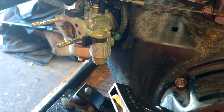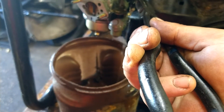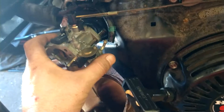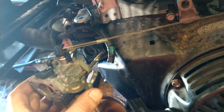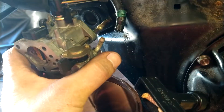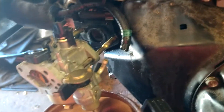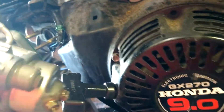Go ahead and pull the fuel line and drain all the gas out — you're going to want to clean the gas tank. Once you've drained the gas, pull the carburetor out to where the studs are, then turn the throttle all the way up and push it straight up so it comes out. Now we can rebuild the carburetor.